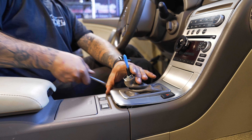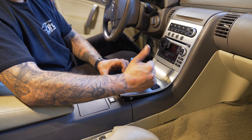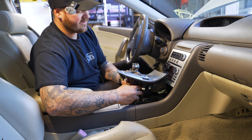With all these plastic interior pieces, you don't want to be super aggressive with it. So once you have the back of it out, you're just going to pull back toward the back seats and then that will release the front part of the bezel.